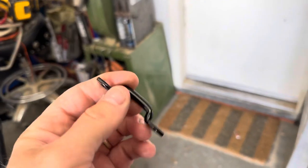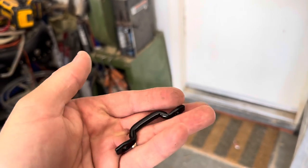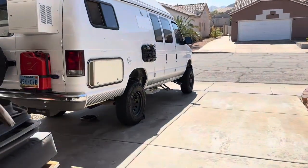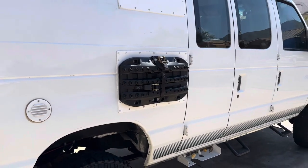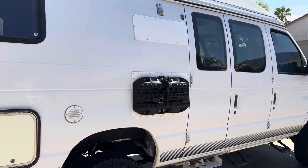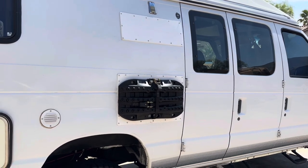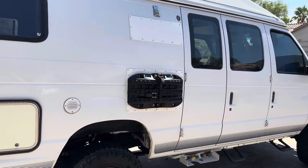So these are what they call a footman's loop — these are one inch metal. There are all kinds of varieties on Amazon, eBay, and probably your local hardware store. These ones are particularly good quality with a nice finish. They're perfect for one-inch ratchet straps, which are very common. I reinforced this panel on the inside, drove those in with some screws so they're nice and tight, and in this case I put on some baby traction boards — but your imagination is the limit as far as what you can use. The more I've used these lashing points on my builds, I think they're a good idea. Even if you don't have something to immediately put on there, it's a nice feature, particularly on a vehicle like this that has a rugged motif and is four-wheel drive.